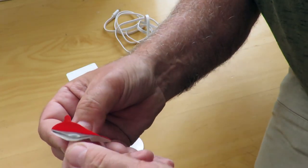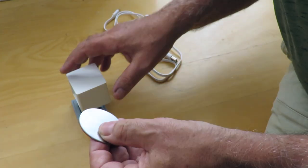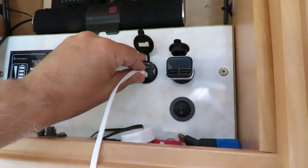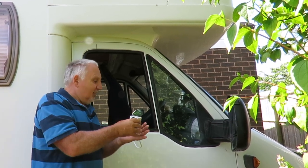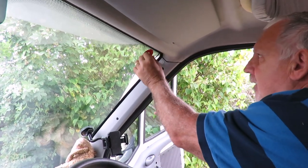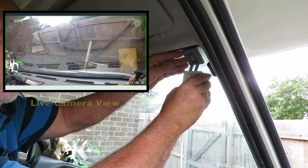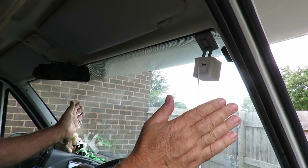The other side of the motorhome I don't need to worry about because it'll be parked very close to a wall. So I just peel off the magnetic base, stick it here, adjust the angle and it should give me everything I want. I'll run and tuck the USB cable in and plug it into the battery pack - I'll be using the leisure batteries for the power. I've changed my mind a bit and I'm putting it up here, sticking the pad onto the window with the magnetic base, which means I can tuck the power cable down the side neatly. That'll give me a good 180 degree view out of the front.